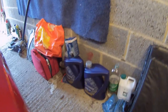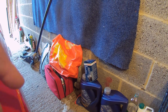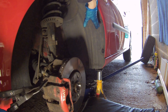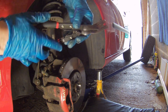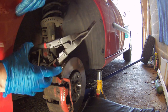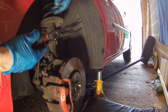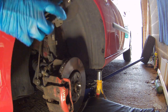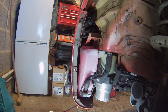I've got other jobs lined up as well. I've got some oil down there - this is Defender manual Defender oil, got some good reviews on Amazon, 10W40 - and I've got a new Bosch oil filter as well, so I will be changing the oil on the Ibiza. Just a little tip as I'm going along: modern cars have got lots of these little plastic pegs that hold trim panels on, both on the outside and inside of the car. Get yourself a pair of these trim removal tools. You just simply slide it under a little peg and squeeze and pop it out. It's much better than going at it with a flat-bladed screwdriver because you end up breaking the clips. It's only about five quid on eBay - absolute godsend.